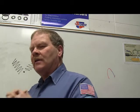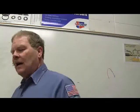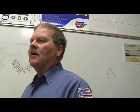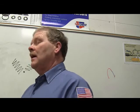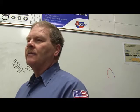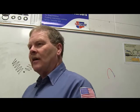Now you guys that are taking electrical, pay attention to what I'm about to tell you. When we disconnect the engine coolant temperature sensor and we short that terminal to ground, what is the gauge going to do? You guys know? What's your gauge going to do if you disconnect the engine coolant temperature sensor at the engine block and you take a jumper wire and you short that wire to ground, what are you going to see the gauge do? Yep. It's going to go all the way to hot. When you unhook the ground, it goes all the way to cold.